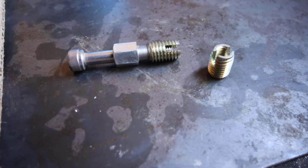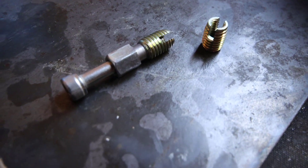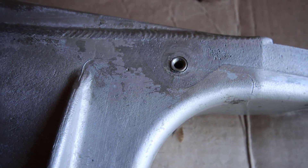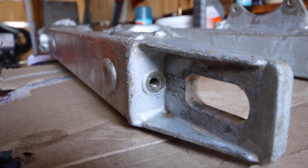This is what the threaded insert looks like — I'll show a photo. This is the tool he made: it's just a normal bolt with a long nut as a collar. You thread in the little insert and basically tap the hole with this. It's very hard steel, and in aluminium it's very easy to thread in — no need to tap it first. This gives you a brand new M6 threaded hole. We did that in two places in the swing arm: for the chain slider fitting and for the big chain adjusting nut at the rear.